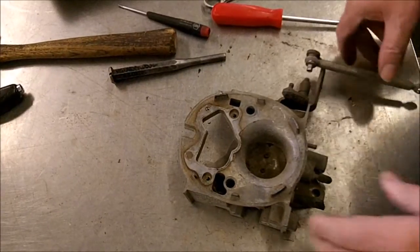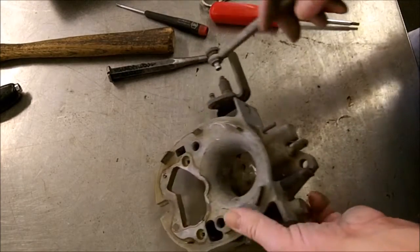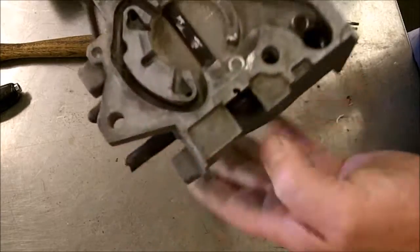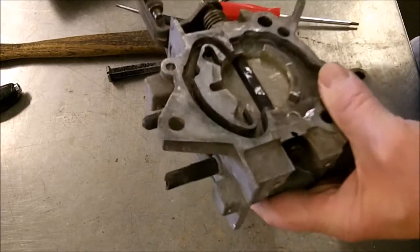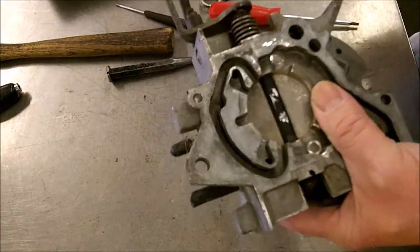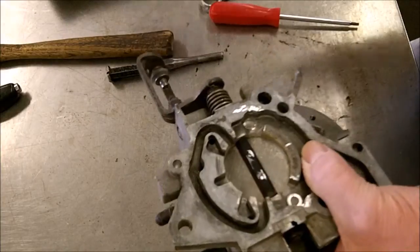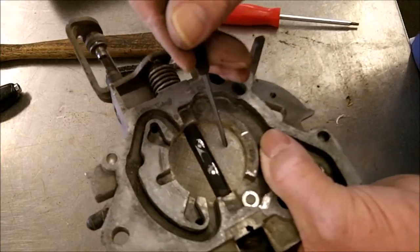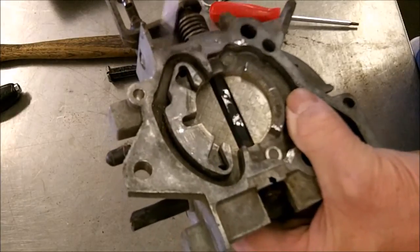Okay, nice fuel parts here again. We're taking apart this GM throttle body injector, and we got most of the parts off. Getting ready to take the throttle shaft out. And remember, these should usually be bushed. They're almost always worn. So first thing I do with these is make a mark on the throttle valve so that you can easily get it back in the same position again.